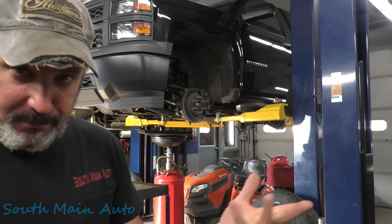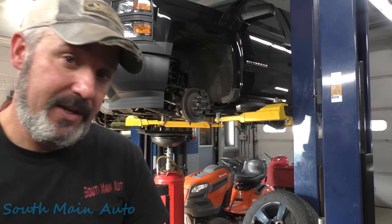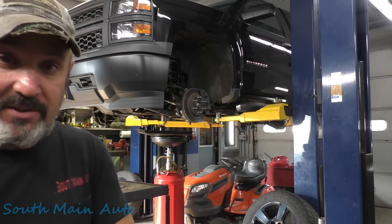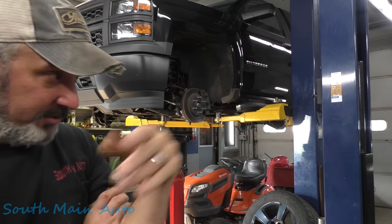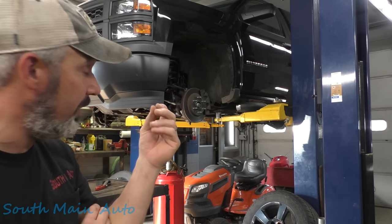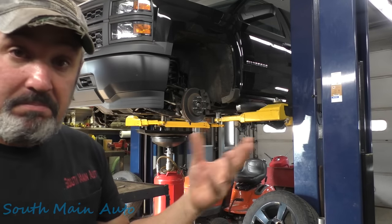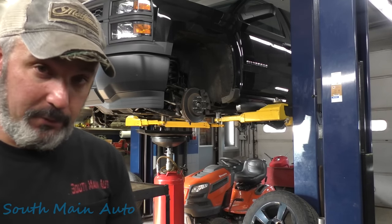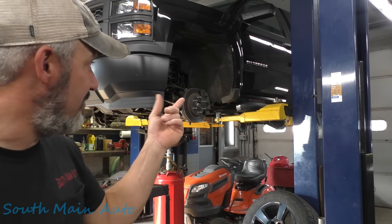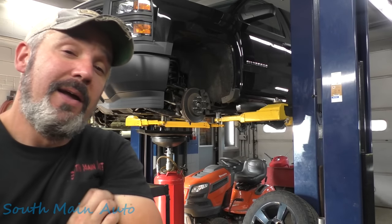So right now it's June, first week of June. And then it's going to be July, and then probably August, and then again September, and it's going to start cooling off here, and then we'll start getting snow, possibly sometime October, November. So if I do it this time of year, when we spray up in the cavities and have areas that we miss a little bit, it does give the fluid film time to really creep around. And you'll really see it, because once the guy drives this thing in about a week or so, it's going to be creeping up the outside of the door and outside of the tailgate,